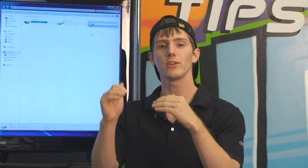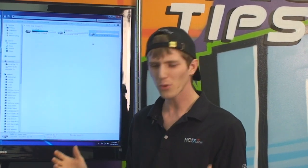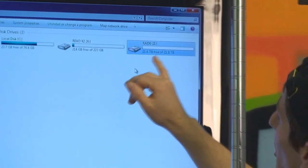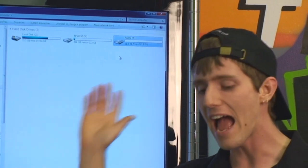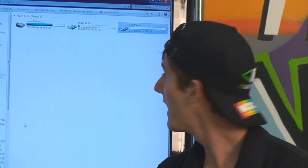Here's the concept for you guys: you know when you buy a 500 gig drive, it's not quite 500 gigs because of the different ways you can measure one gigabyte — it can either be 1024 megabytes or a thousand megabytes, depending on how the manufacturer defines it. What if I told you that with your 24 drives, you're going to lose over two terabytes of space in the math conversion? So this is our 24 terabyte RAID 0 array. I would never ever recommend in any production environment running 24 mechanical drives in RAID 0. That's incredibly stupid — if even one drive goes down, you lose everything.